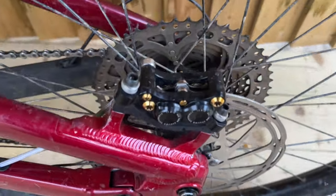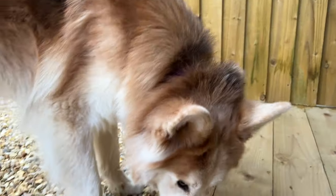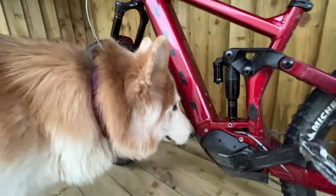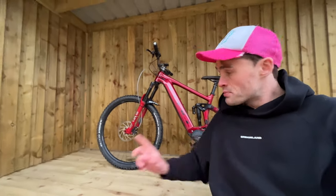The caliper is very trick — the gold bolts on it look great, and the front brake also looks quite epic. Another thing worth pointing out on the Titanium brakes is that the pistons are bigger all around: this has four 17mm pistons per brake, whereas the LH4 has two 17mm and two 14mm pistons. So you're getting more stopping power per brake per set. I've got metallic pads on these and they've been great so far on the e-bike — I've never felt like I need more power.